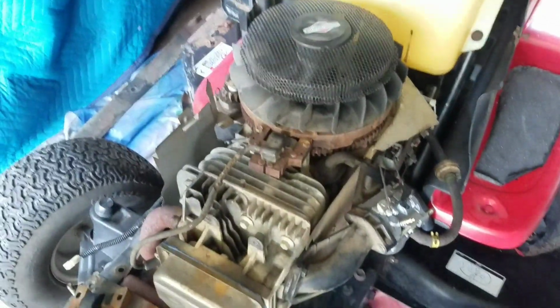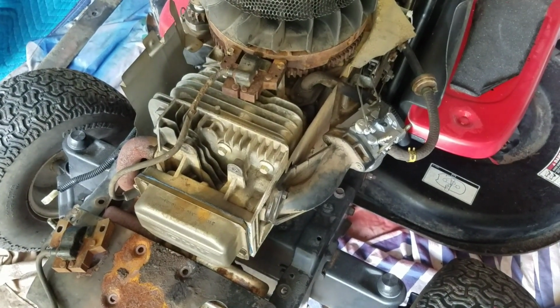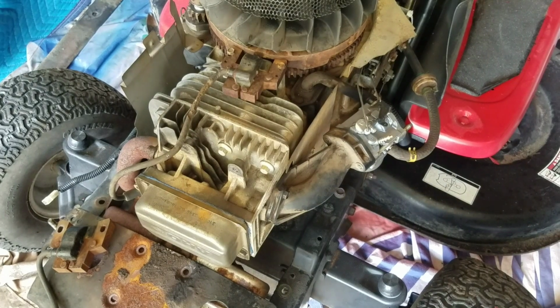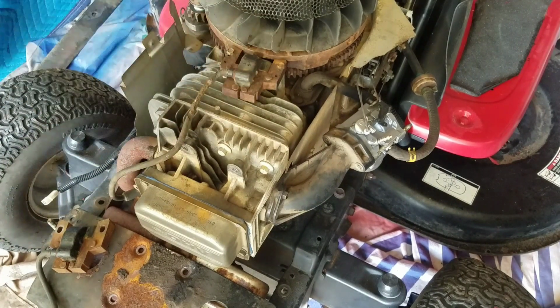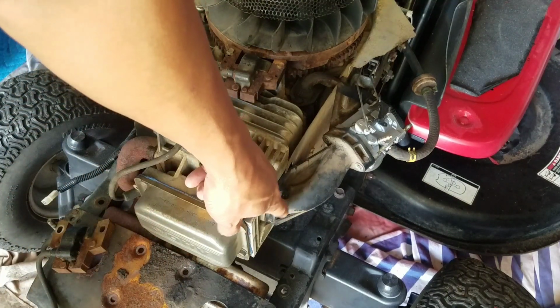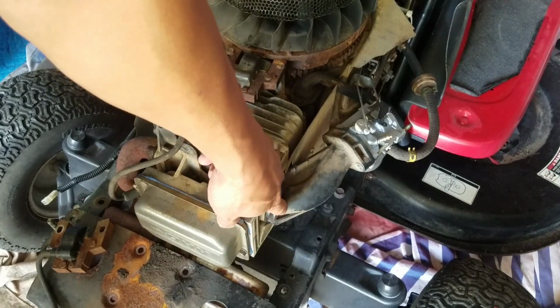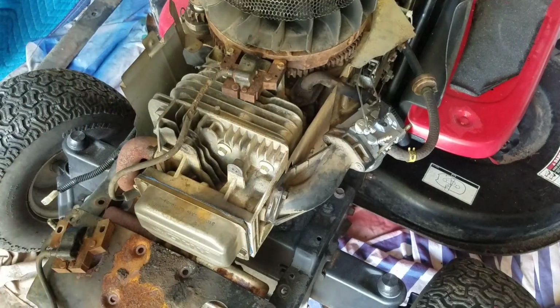I went back to my pictures of this engine, which I took off of a Craftsman LT 1500, and it had the bad synchro balancer, which I rebuilt, right? I was looking at the old videotape, and actually, you know that half moon cutoff part here in the intake manifold, that gasket, it actually belongs on the top. Look at this picture.